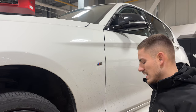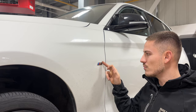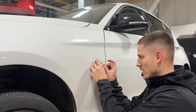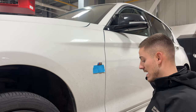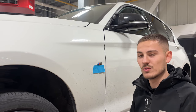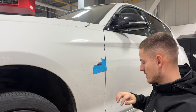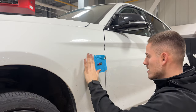The best way to do these would probably be to clean it off first, which I will do. But chances are these are going to leave almost like a residue behind where the paint is discolored over the years. If you don't want to risk it, just tape it up exactly where the badge is and go around it. Once you pull that off you can take all the remaining tape off and stick it straight back down. You can use a cheese wire rope or even dental floss.